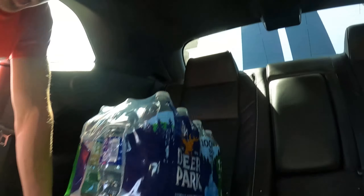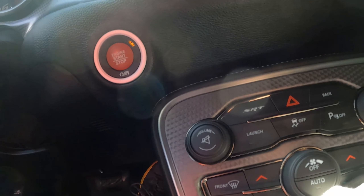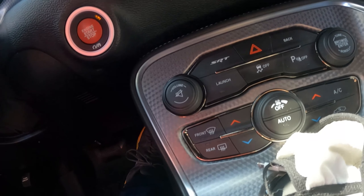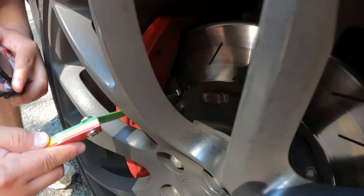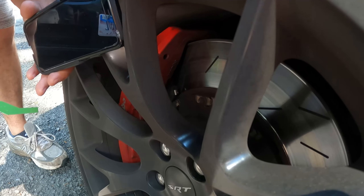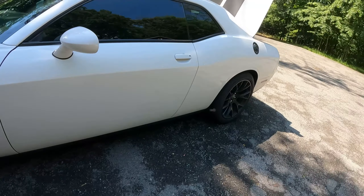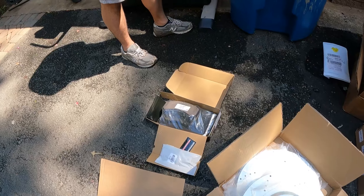This right here is the secret to extra traction in the Hellcat. You see this thing right here — inside that is where the meat is for the brake pad, and there's not a lot left. The rears measure at 7 millimeters, the front is about 3. The pads that come new are about 9 millimeters.